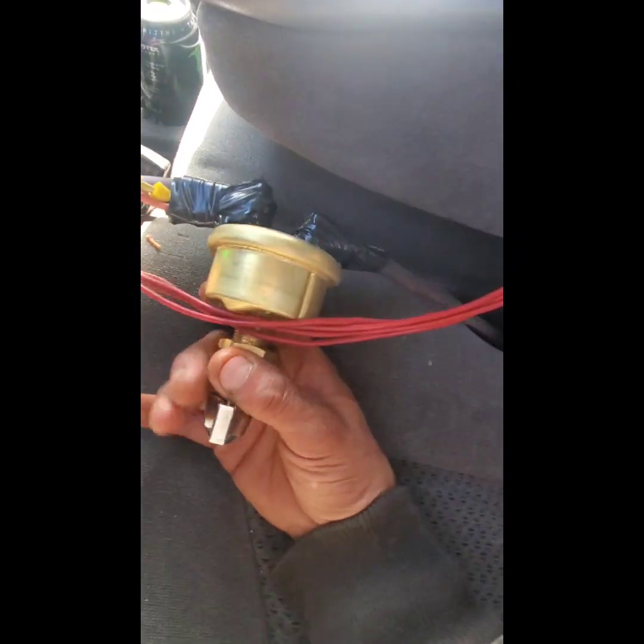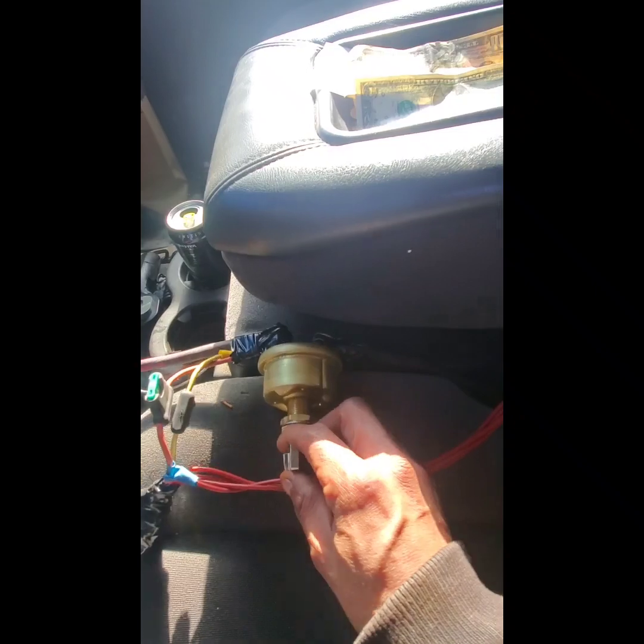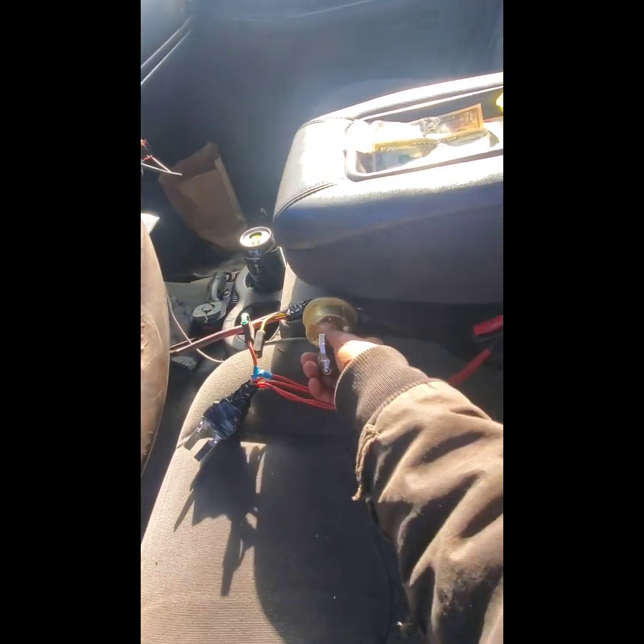So I hardwired it straight to the battery. I just took regular battery cables and bypassed the module. I went to Advance Auto Parts and they sold me this - it's called the two-way switch solenoid. It's just a straight direct on and off - once I click it, I got the spreader wired up right to the same cables and then I got my vibrator and my lights hooked up separately with their own fuse. This literally just runs to the battery - this side goes to the positive, this side goes to the positive in the back, and you just run your ground to the battery. This saved us a whole lot of trouble - sixty bucks for this piece right here.